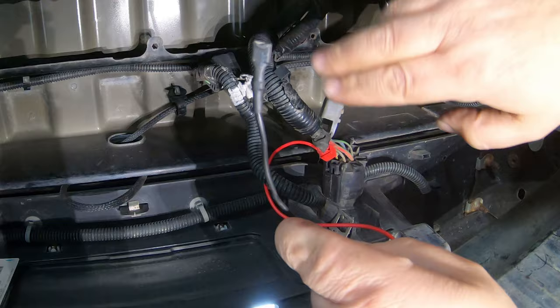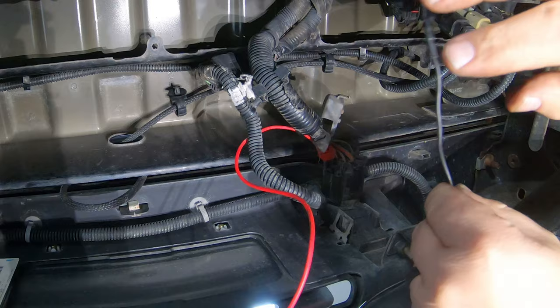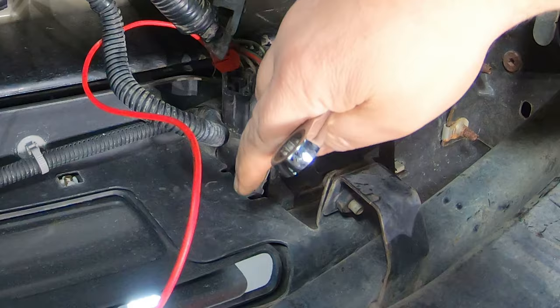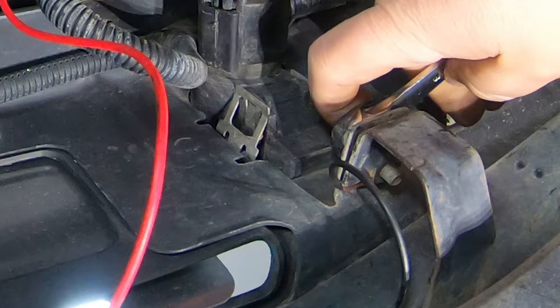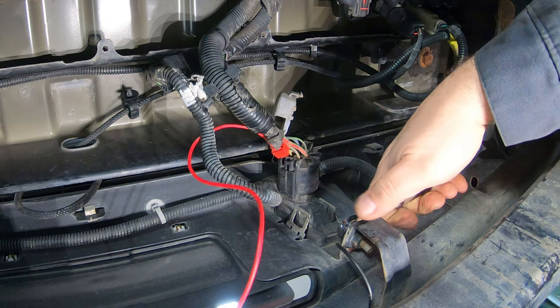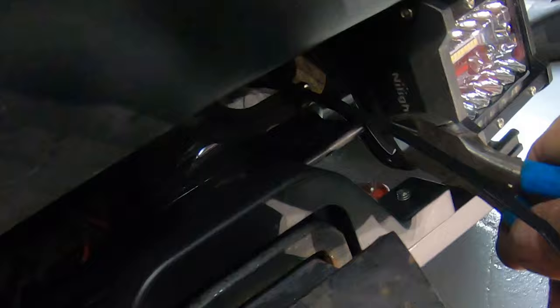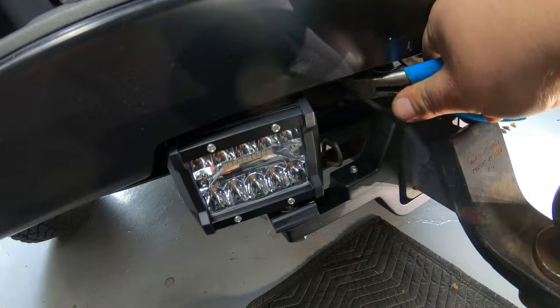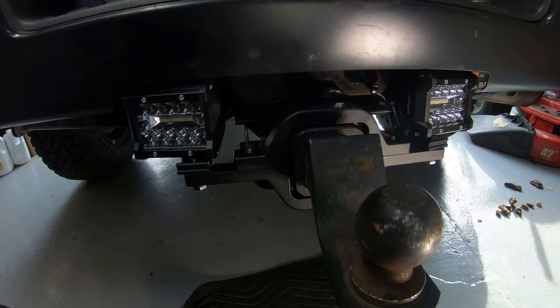For the ground wire, this can go anywhere on the body — just find a bolt to ground it straight to the frame of the vehicle. That gives you your positive to the red wire when the reverse lights are on, and the ground goes back to the vehicle chassis. I loosened a bolt that holds the license plate bracket — it's a metal bracket that goes straight back to the frame. Just fish the ground wire back in there and tighten it back down for a solid ground. Then take zip ties, secure all the wires so they don't get into anything. I zip-tied the wire up to the factory chain connector we won't be using with this hitch — gives it a nice clean finished look with minimal visible wire from behind.